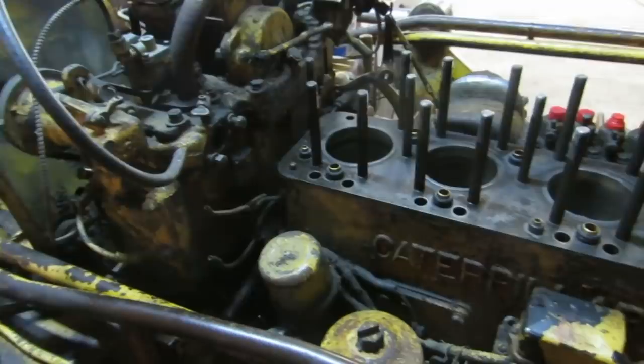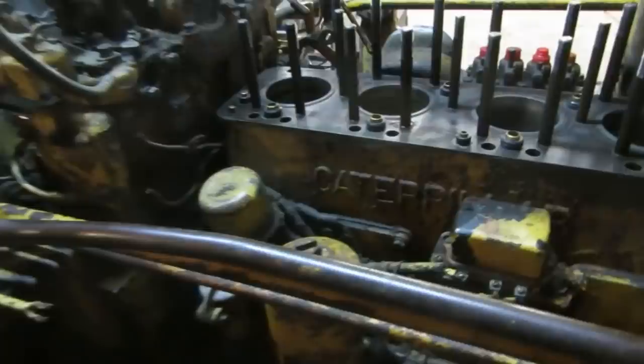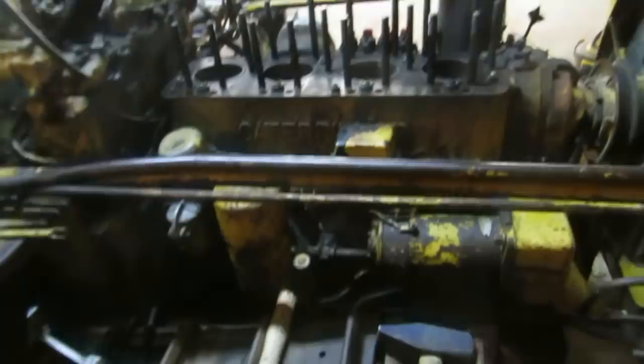Well, there's a pup motor. Yeah, the pup motor. And its exhaust runs through the intake, and its coolant too. So if you leave the pup motor running, it runs on gasoline, spinning the big motor over, and eventually she starts. Oh yeah, it has no choice.